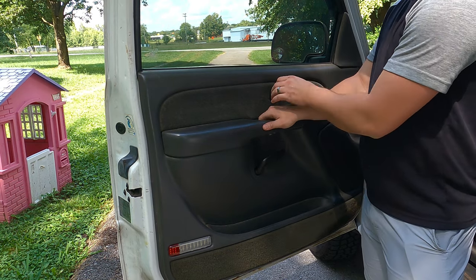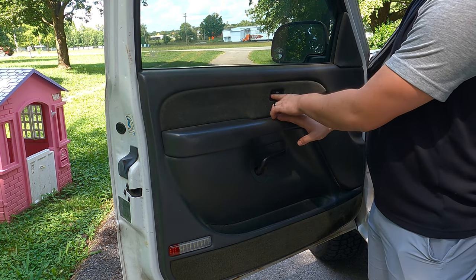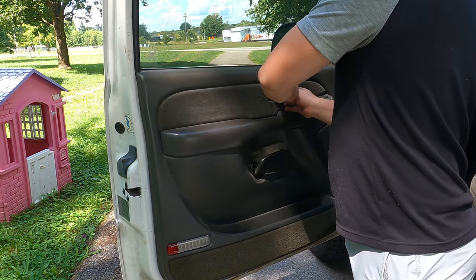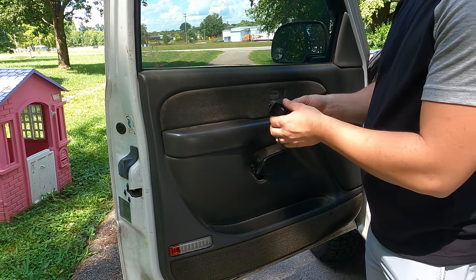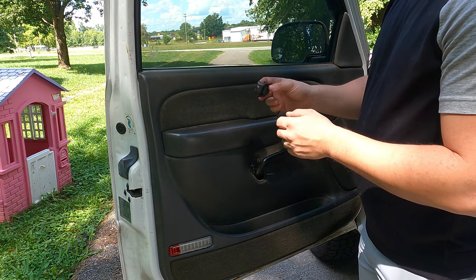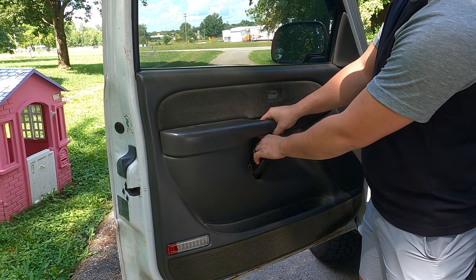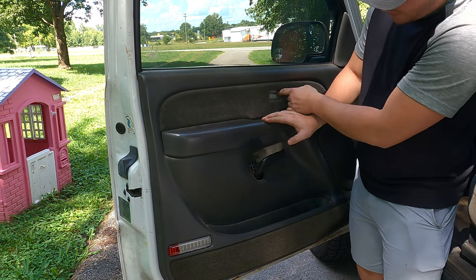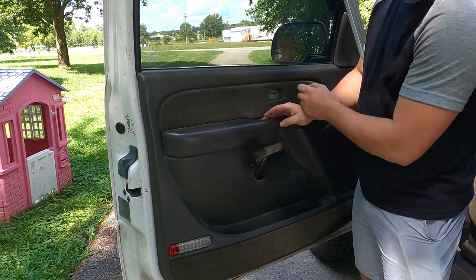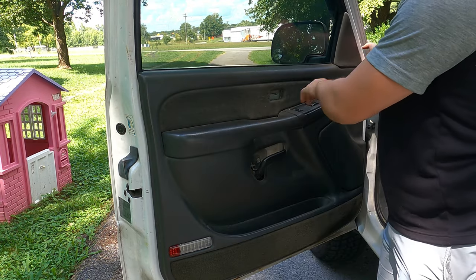There's a bolt right here and a bolt up in here that you just zip out — those are seven millimeters. That was easy enough. You could use your nails or a flathead screwdriver, but if you're using a flathead you don't want to break any of the clips. A plastic panel tool would probably be ideal. Remove the little bolt here — mine actually broke off because of my door panels — but there will be a little brace and a bolt up behind the lock too.